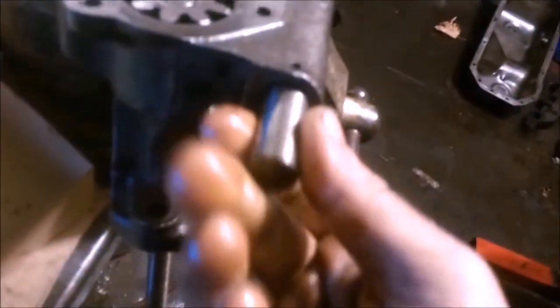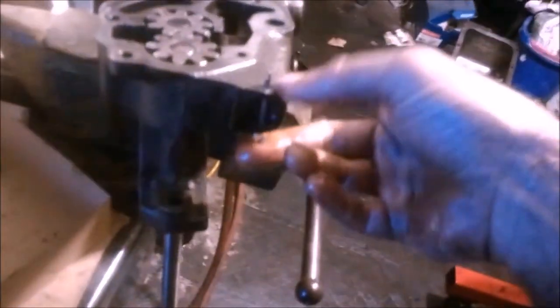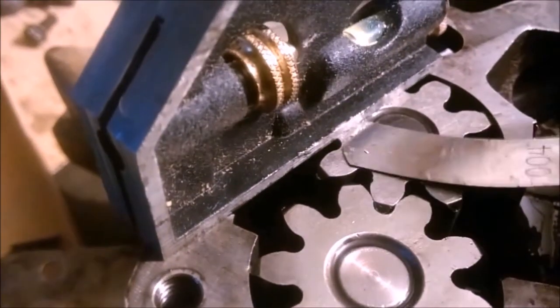We pull the cotter pin, pull a spring, and out comes our little piston. Simply reinstall our piston chamfered-end inward, new spring, insert our retainer washer, and we'll bend both ends right over. This is the relief valve — it pushes against that spring when pressure gets too high. As you can see, these gears are flush with the top.